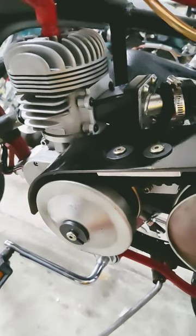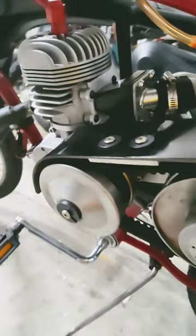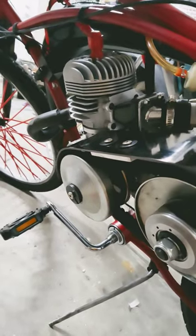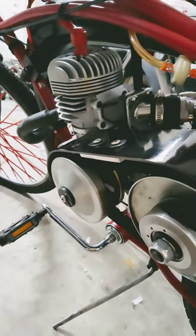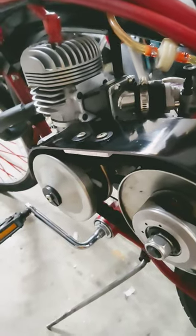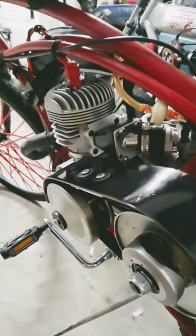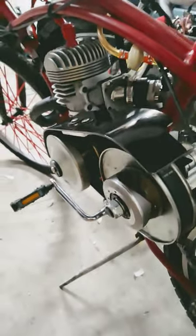I made my own custom weights, figured out the math to it, and used my own spring tensions. I got it opening up to about 750 RPMs max, and at around 2300 to 2500 RPMs it's fully engaged, which gives that engine about mid throttle — and then the rest from there on out is clear send.